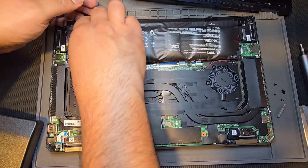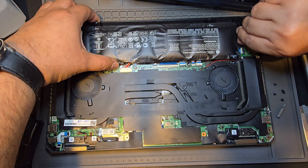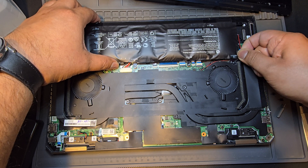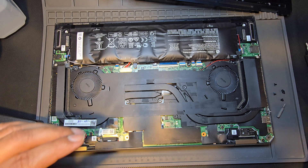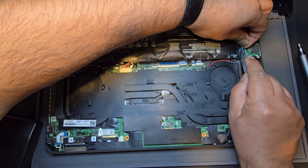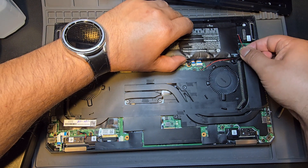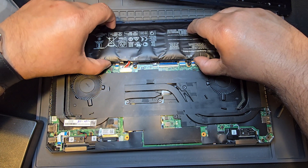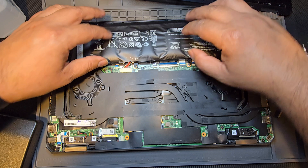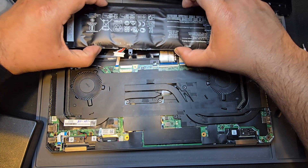Careful. We've got to do the same thing over here — push in, up. This one's got tape on there. The last thing you want is for this to pierce, so carefully let's cut that tape. Do not cut the wire. Do not cut into the battery. Now see if we can't get it from there to there. She's coming out now. There's going to be a cable holding it — which is this power cable right here. Remove it — and the battery is completely out.